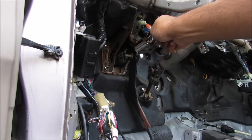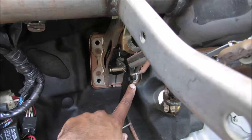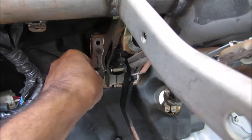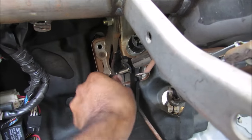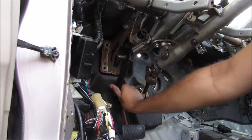There's a total of five bolts holding the brake pedal assembly on — one at the top and then four going around. In order to disconnect the brake pedal from the booster there's a little cotter pin here that holds this pin. I'm going to remove that and slide out the pin, and then I can remove the brake pedal assembly.